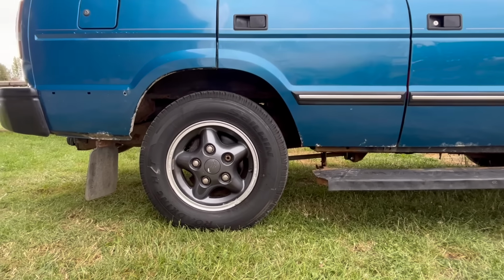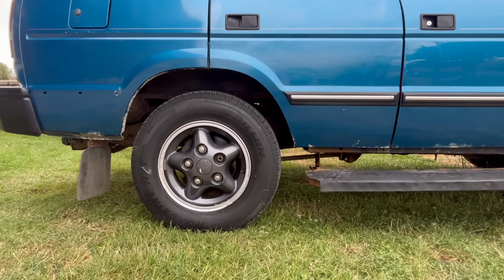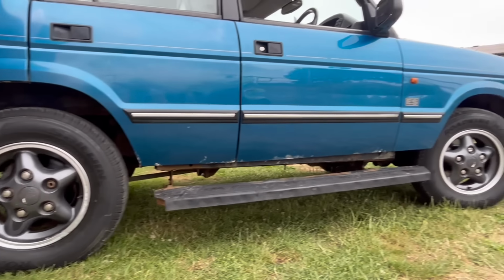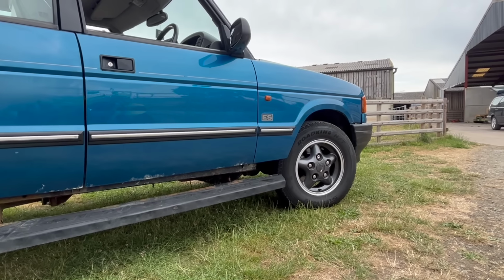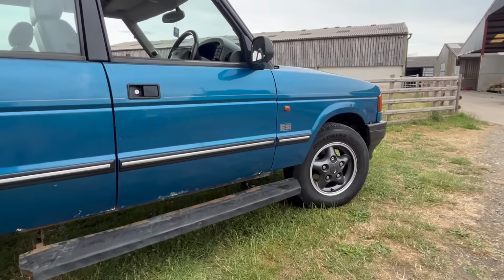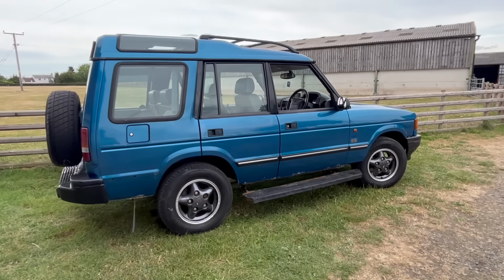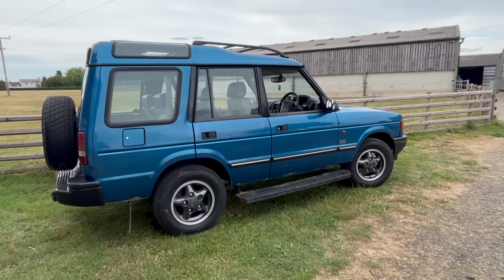And it's leaking a bit of air out of the bead around the alloy wheel. So I suspect the alloy wheels have got corrosion on the inside. So you probably want to go around the inside of the alloy wheel with your wire brush whilst you're doing that and reseal all of your tyres. Road King tyres, because it is the king of the road. I do actually think that it is properly lovely.